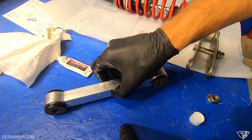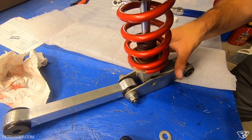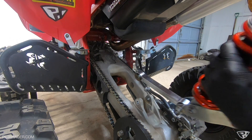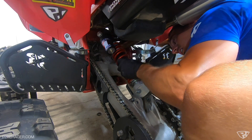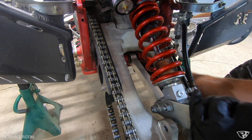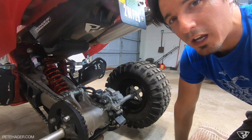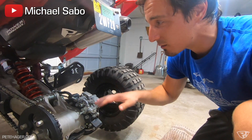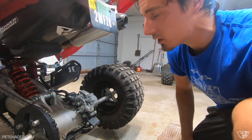I've got this thing packed out with grease here. Let's try to put this thing back in. I was going to tighten everything because I have this up right now, but I just talked to Sabo — shout out to Sabo — and he said to make sure this is on the ground whenever you're torque tightening shocks and linkage and stuff. So we'll put it back down, torque it all up, and the rear end should be good.